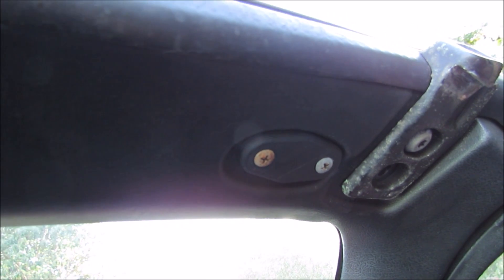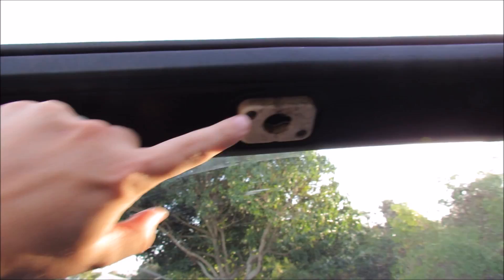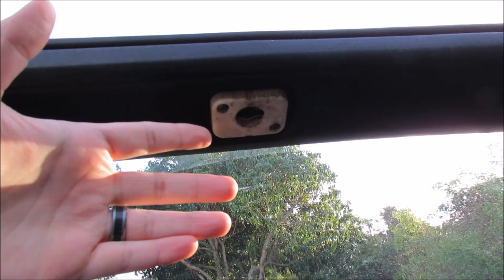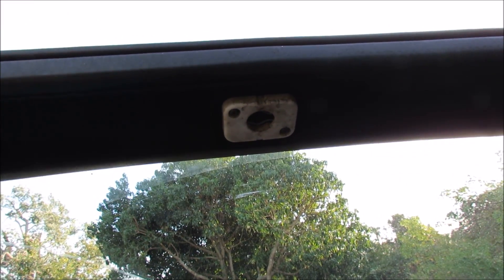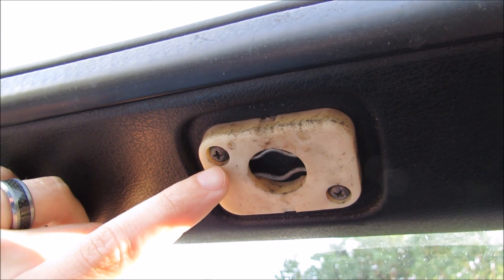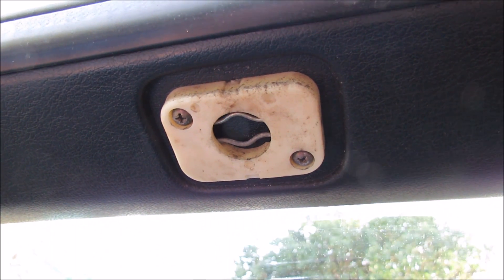If you remember these block off plates that we made before — here you can see the other side. I haven't painted those screws but I will be today, because in today's episode we are going to be replacing this. This is normally where you would mount your rearview mirror. This car never came with one. It should be simple enough to replace — it's a couple of countersunk holes and a standard block off plate, so let's go ahead and model that part up.